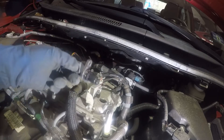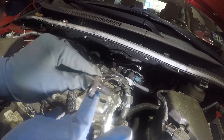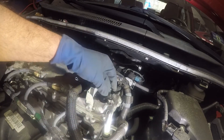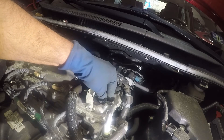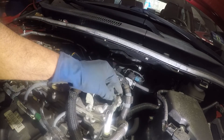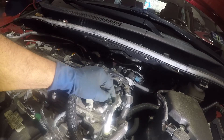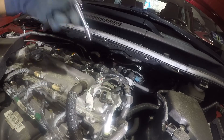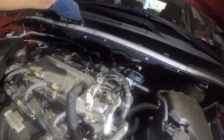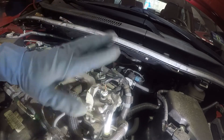I am waiting for the new one to finish out this video. What you're going to do is take fresh oil and put it around the new seal. Inspect — this is nice and clean, so you don't have any oil leaks. Simply take the sensor and you should feel it go in a little snug. After that, take your bolt and put that in. Take your ratchet and give it a very light, snug tight — not crazy. Then take your connector and make sure you hear a snap, and you're all done.